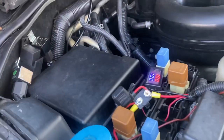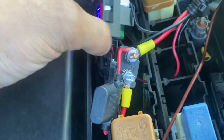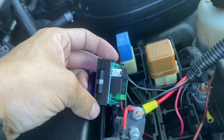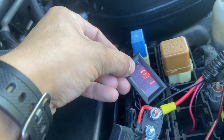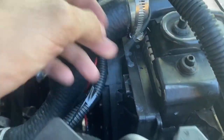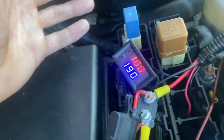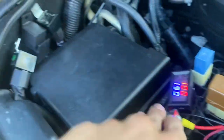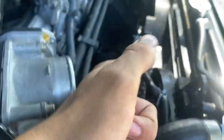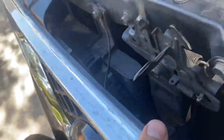For the high speed, I used a pretty basic Amazon 20-amp harness, and I used this temperature controller I got off Amazon for around ten dollars. This just reacts to temperature — it's fully adjustable. I normally set it to about 190 degrees at the radiator. It has a little probe that connects right here. The block temperature sensor is way under the manifold, so it gets actual block temperature, but by the time the coolant reaches the radiator it's about 10 degrees cooler, so it realistically keeps my temps around 210. This runs through a circuit breaker, out to a relay, sends power to the main fans, and I also connected a small 10-inch fan for the radiator cooler.